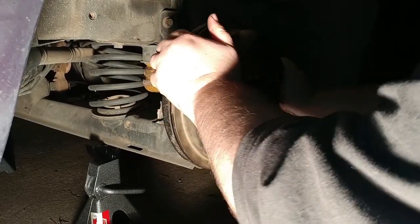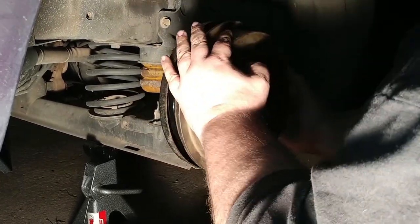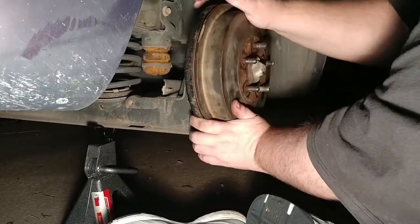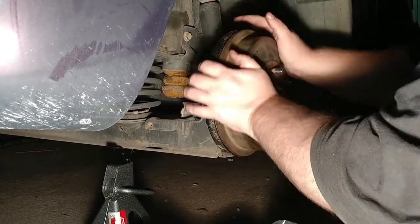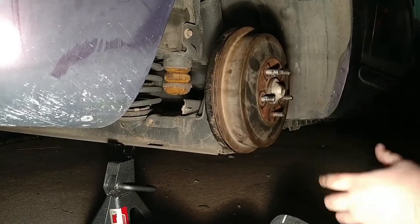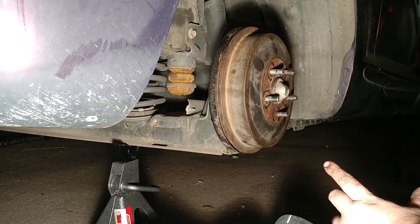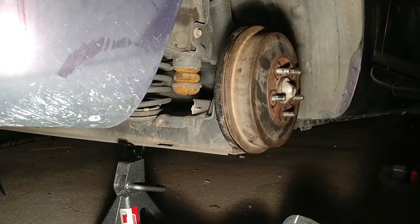These things will kind of center up once you hit the brakes on them. Well, I'm gonna call this good, guys. You can see I'm just touching, like it's got places it's just there. It's turning freely, but it's hard to explain the spot that it's at. It's just before the brakes start causing resistance on your drum, okay.